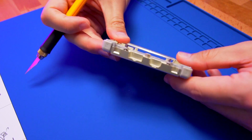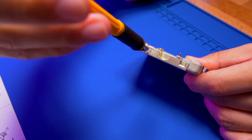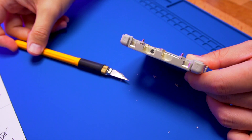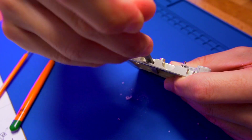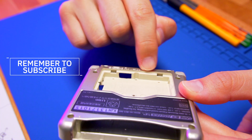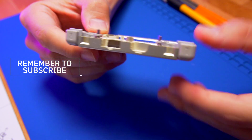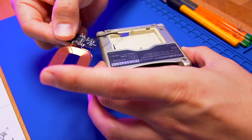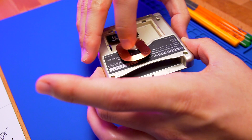The reason for this is: first, to provide additional space behind the port for the wires we'll be soldering, and second, my intention is to place the charging receiver inside the battery compartment behind the battery door. I'll be using my craft knife and a file — no need for power tools here. Now that we have our hole made, feed the wires of the wireless charge module through the hole so we can go ahead and solder them to the charge port.